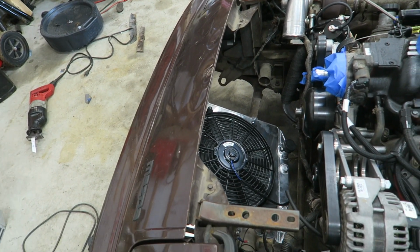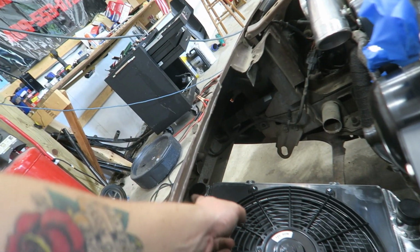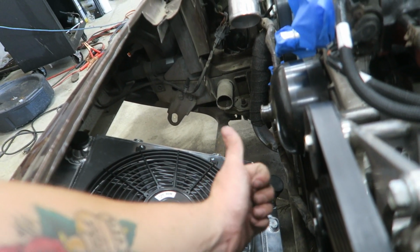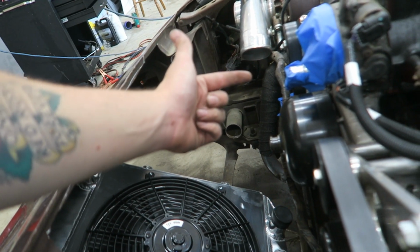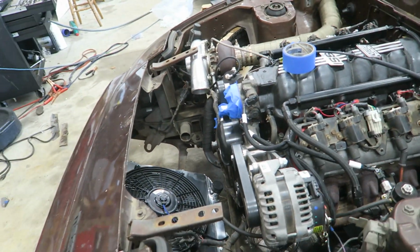You get it. And it looks like the inlets and outlets should work. That one I'll probably just put a 45 silicone coupler and then go straight into the upper. That one I'll probably have a 45 coming this way and then a 90 up into the lower port on the water pump. Should work pretty well.